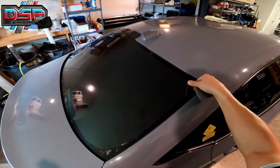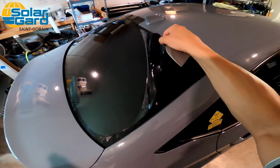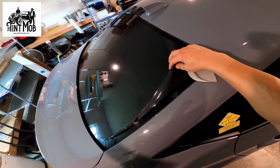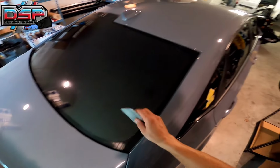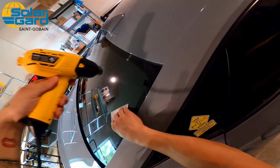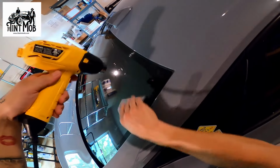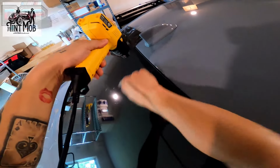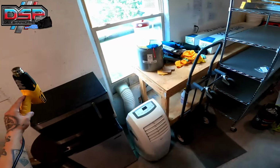All right, that's shrunk, lay it down flat, lift it up halfway, lay it down. When you are laying this down, be careful. Make sure you lay it down here. Don't lay it down and then move it because it will crease. So lift it up, lay it down. Again, we're gonna be tight in the corner and off the sides and up to 2 inches. And we're just gonna double snap that top edge. And what that's gonna do, again, is tighten it up just a little bit. Boom, just like that.